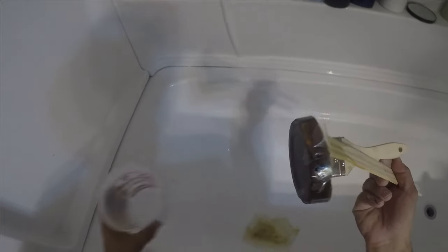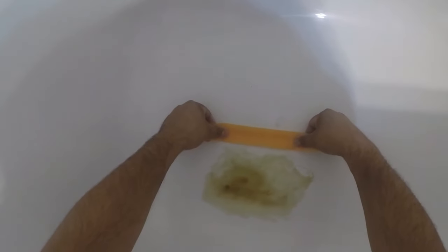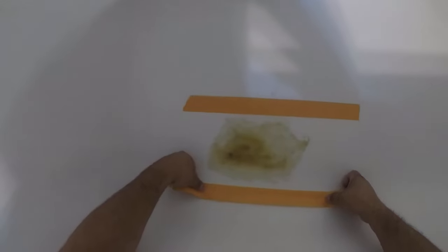Now I've already waited — one thing I do is leave the material in the cup and look at how hard it gets, then start tapping it onto the surface. Usually the surface takes longer because it's thinner when applied, but overall it'll probably take about a good hour. You can use a heat gun to speed up the process as well. Then I tape off the area to get ready to start putting on the Bondo glass. The tape helps guide me because the rest of the tub is in pretty decent shape.